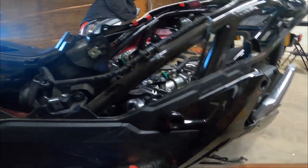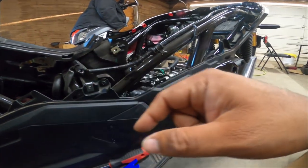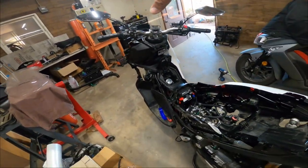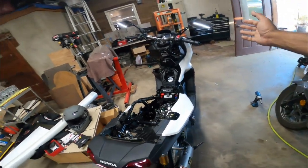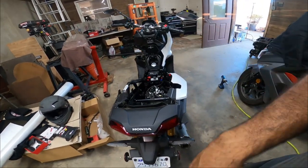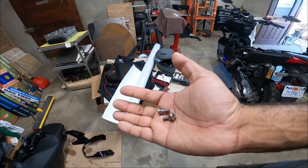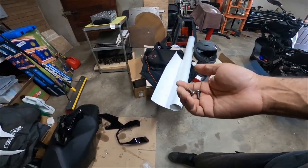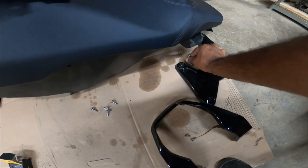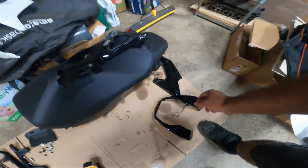Then you have the cosmetic ones with Allen bits — these are recessed slightly and are strictly for aesthetic purposes. My tip: when taking one whole side apart, leave the other side intact so you can use it as a reference for where specific screws go, in case you mix them up. The cosmetic Allen screws hold pieces like side covers down, and the little body grommets hold two pieces of plastic together quickly — you'll find them in odd places.